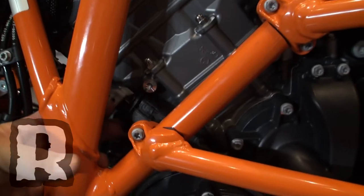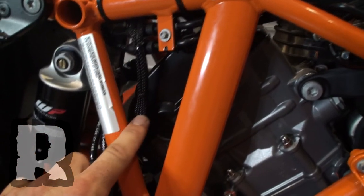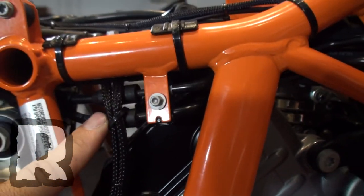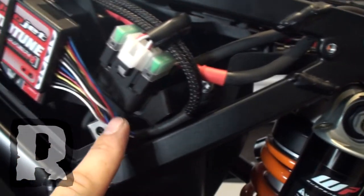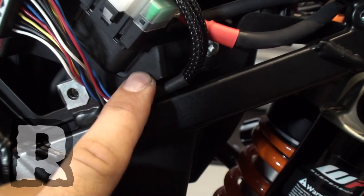The connection cables end up right here on the right-hand side of the bike. The front and rear cylinder wideband O2 wires trace up the frame here — I run them right over the two ABS brake lines. They come up, blend into the loom right here, come back down through the frame just to the right of the battery, and then plug into the auto-tune nicely. Right where they're heat-shrunk, they tuck into this little crevice really nicely. That's the wideband O2 part.